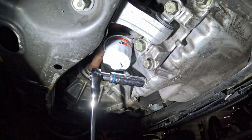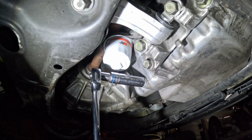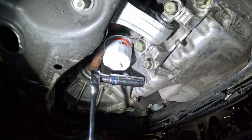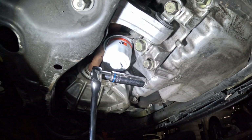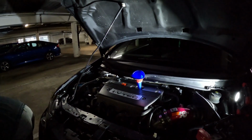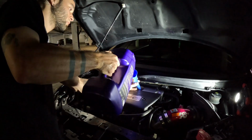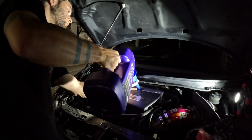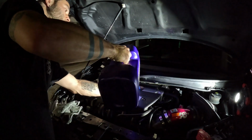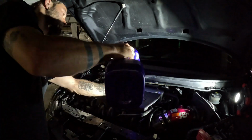Now see, I'm here now tightening the oil bolt, but I will say I should have used a much more shallow socket. As you can see, it's coming off, so that's my bad. My drain bolt's pretty beat up here, and it doesn't really sit on there too well, and I don't have a torque wrench. 32 foot-pounds would be the correct torque for the oil drain bolt, but I just did it about a quarter turn. It should be enough to keep it legit. No, I'm not gonna lie, guys, I got the worst angle on this. You absolutely cannot see what I'm doing, and I also filmed this in time-lapse on accident.